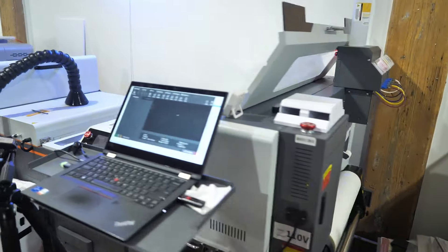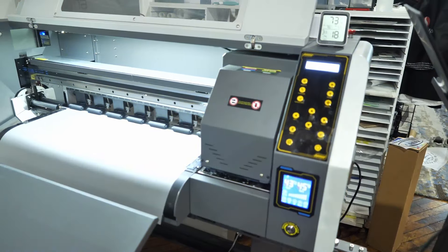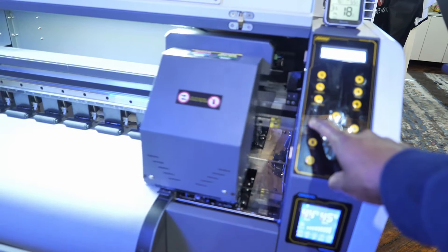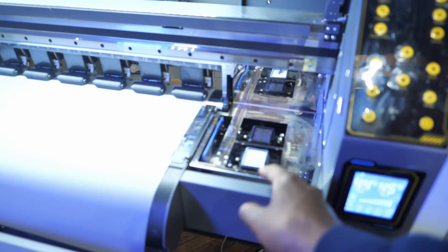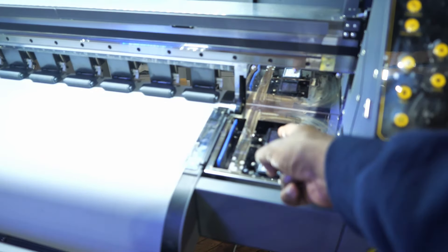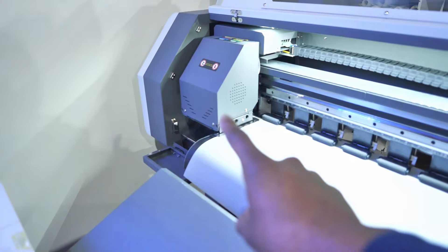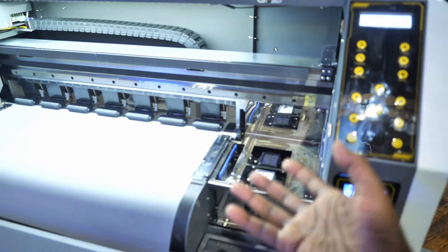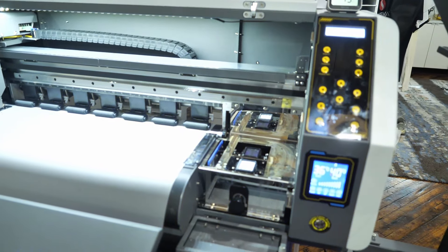So let's talk about some nuances about this printer. The reason you don't have to worry about print heads getting clogged on this particular printer is because at the end of the day, when you're done printing, you press this button right here, the print head goes to the other side. You clean these channels with a lint-free wipe and cleaning solution, then fill each channel with a syringe. Press enter on the screen, the print heads come back over and this automatically goes up — the print heads sit inside cleaning solution every night while you're not using it. It's impossible for the print heads to clog.